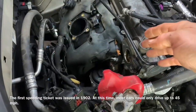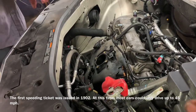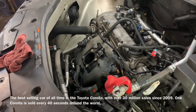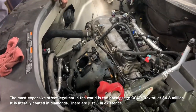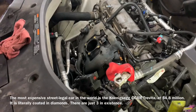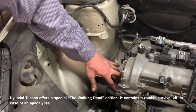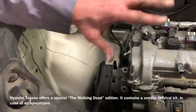I asked Frank what size the lines were on the high-pressure fuel pump and he tells me 11/16ths. Most of us know that everything nowadays is metric, but Frank has been working on cars so long that he uses standard tools to do metric jobs — which means he's been working on cars a lot longer than I've been alive. For the motor mount, loosen it by taking the two big 18 millimeter nuts off, then take the two 15s out, and leave one 15 bolt in there just to support the engine so you can do the rest of the work.